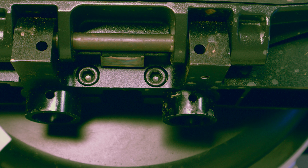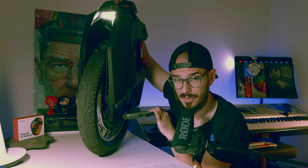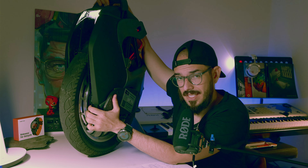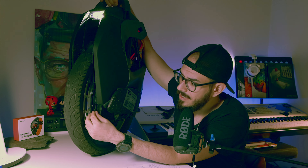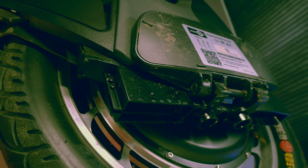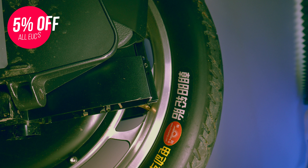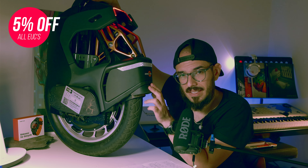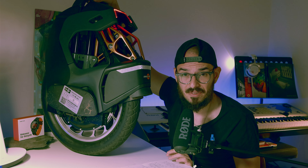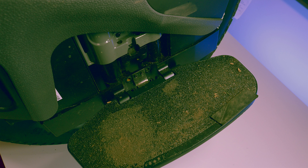The pedals can be adjusted up and down, but to take them out you need to remove four screws and disassemble the pedal, which also has a very tiny screw on the bottom that I don't have at home. I tried to remove it without taking off the pedals, slightly damaging the grip tape. There are also two screws on the corners, and once again we can see the lack of quality — same issue as the 16x where the screw starts to come apart. I also really hate how sharp these corners are. When we talk about the mudguard, until now it stays in place but it feels really flimsy — it's basically just attached in one place, which is why many of you have already broken it after a couple of kilometers.